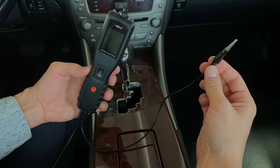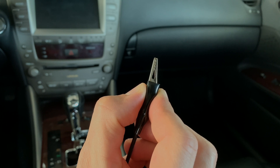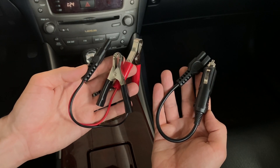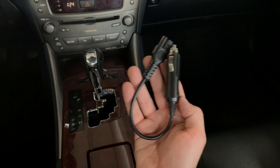There's also a cable with an alligator clip for auxiliary ground connection, which will allow you to test resistance on components outside of the vehicle. You can power up this tool using battery clamps, which is the preferred method for several reasons. But if you can't easily access the battery, like with many European cars, you can also use the cigarette lighter adapter.